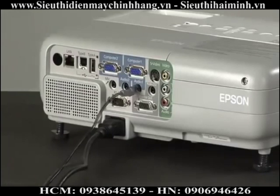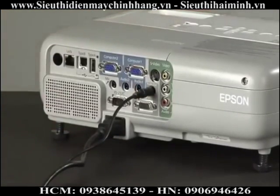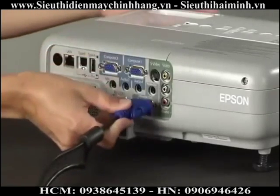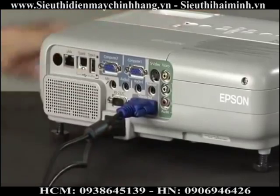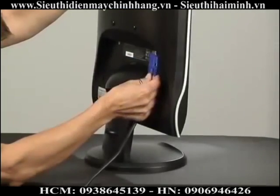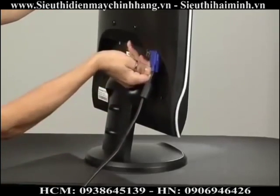If you want to attach external speakers that may be louder than your projector's internal speaker, you can do that too. Simply connect them to the audio out connector on the back of the projector. To have multiple screens or to see the presentation on a monitor facing you so you don't have to turn around as you present, simply connect another VGA cable to the monitor out connector on the back of your projector and to the back of a monitor.